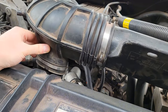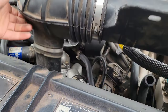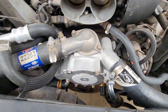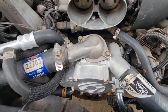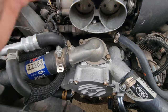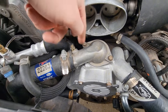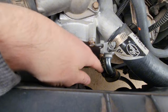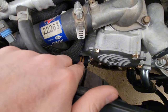I'm going to go ahead and continue to remove this — there's one more hose back here. Pull straight up and out of the way. That will expose my brand new shiny water pump that I need to remove once again. I'm going to try to remove as little as possible, so that means we're going to do these two bolts and pull this up rather than removing the hose. There are a couple of other hoses we're going to have to remove here, and a connection here which I'm going to leave on until I remove all these — if there is any water that spills down I just want to keep that area as dry as I can.